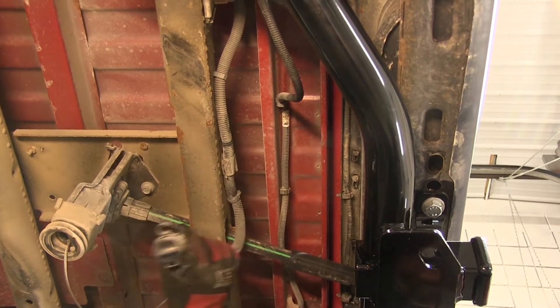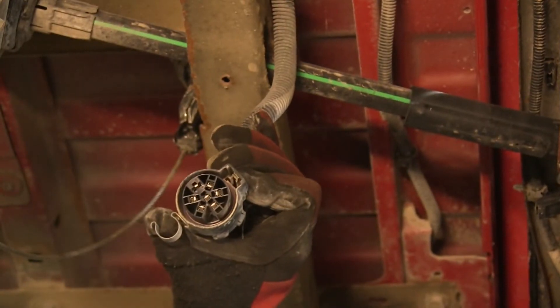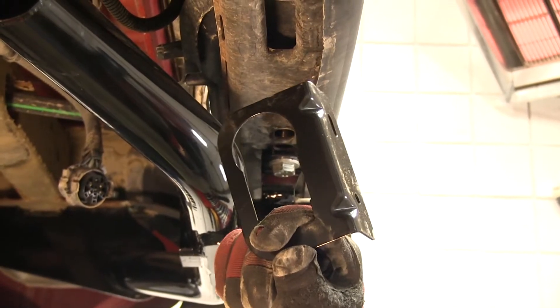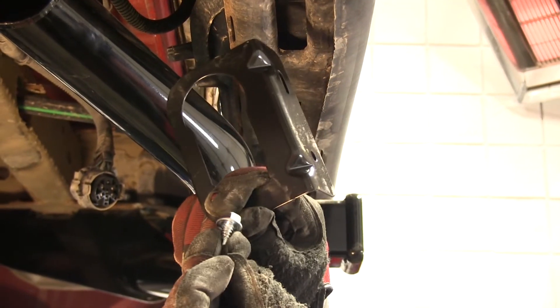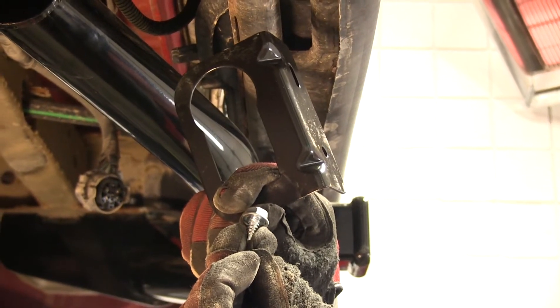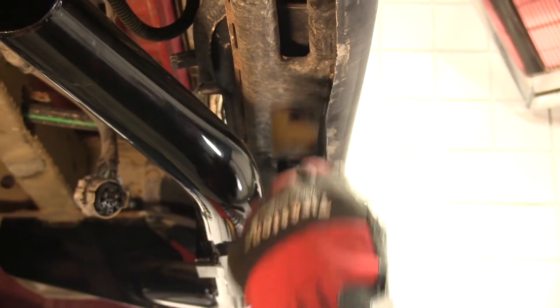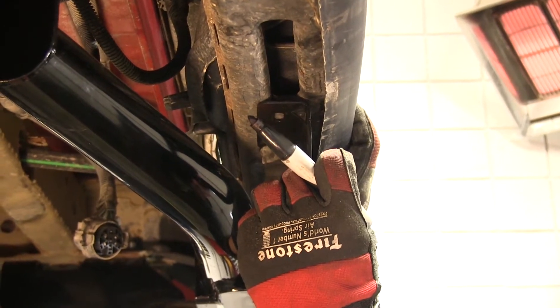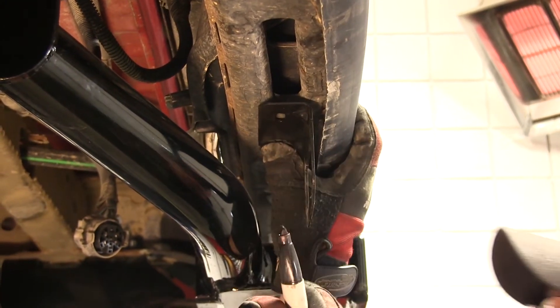Press on the lock and remove the 7-pole cap. Next, let's go ahead and mount our new bracket and install our 7-way, which we'll be fastening with the self-tapping screws that are provided. I'm going to go ahead and locate where we want to install the bracket, and then put a couple marks through the bracket attachment points just to help keep me lined up as I install them.